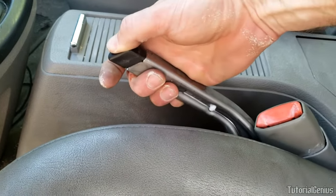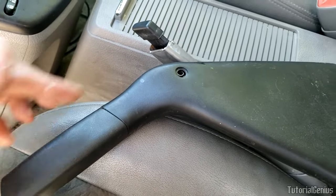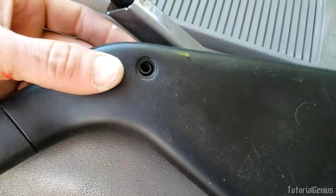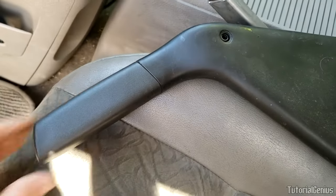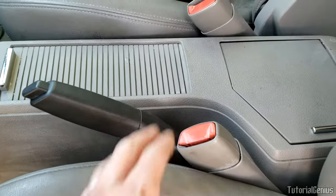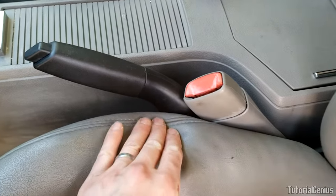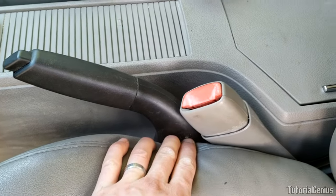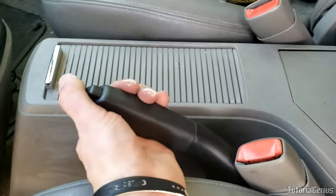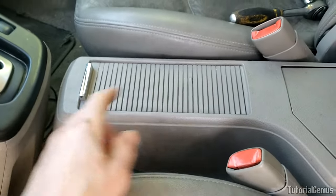Once it seems well adjusted, we put the sleeve back on. Note that this part pulls out of the lamb-chop-shaped plastic piece and the holes must line up so you can get the bolt through — otherwise this bit will disconnect from the rest. Once the sleeve is back on, manipulate the plastic and pull it up and over, then put the T15 Torx screw back in. Give it a final test to make sure everything is secure — and that's it, all done.